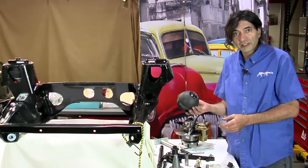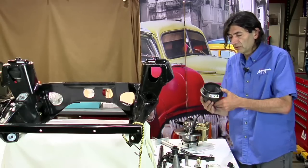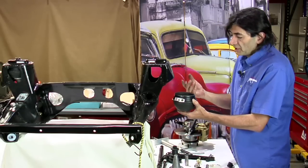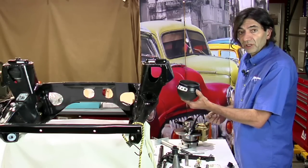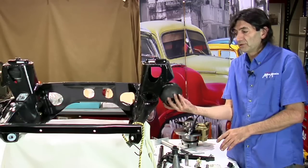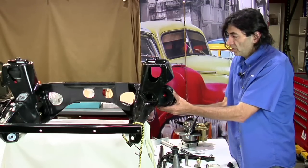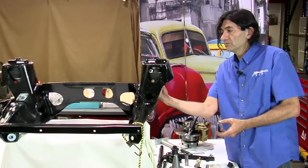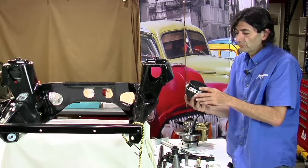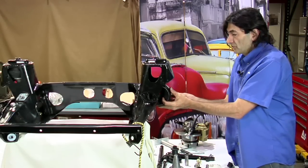In this case, we're putting this stock like it came off the factory assembly line, so we've got the dry suspension. We are going to use a spring compressor. I've actually had people call me and tell me there's a defect that the spring doesn't fit into the frame — and yeah, they don't go in that way. If you have the arm in place, some people say you can finagle them, but I've never found a way to take these out with the lower arm in place. Putting them in, you turn them sideways and the cavity up there is larger. The large side goes up against the collar inside the subframe, and here's the threaded end.